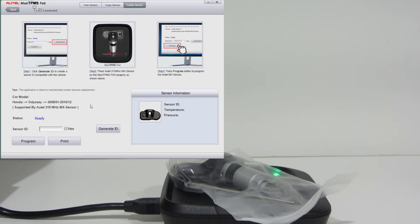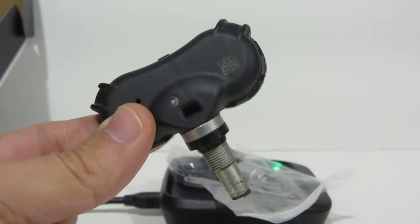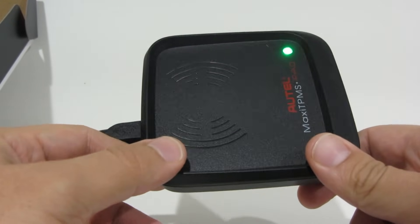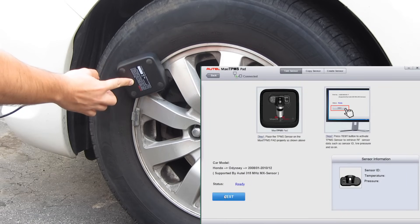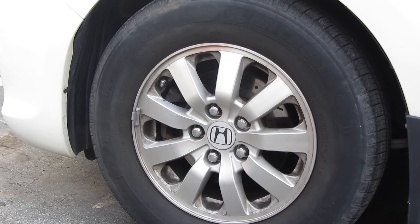There is another way to do it. For my winter tires, I don't have the sensors out of my all-seasons, but I want to be able to copy them. This will actually work reading the sensor while it's still installed in the tire. So here I'm outside — I brought everything outside, a laptop and the pad. We're going to look for the stem and then put the pad right over the stem, then hit that test button. And there you go — there's the code. So it will be helpful to go around to all four wheels and do that same thing, write down the code, and then you can go back inside and program all four sensors.